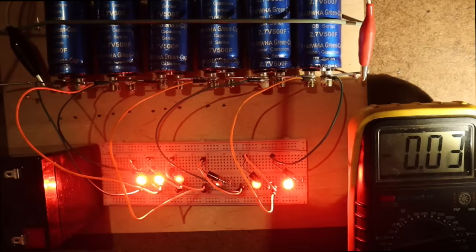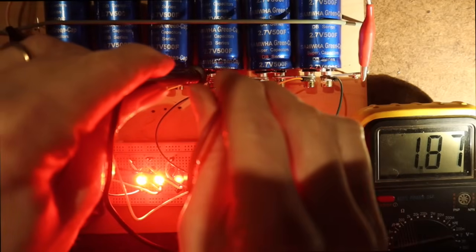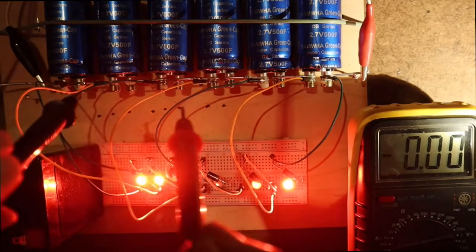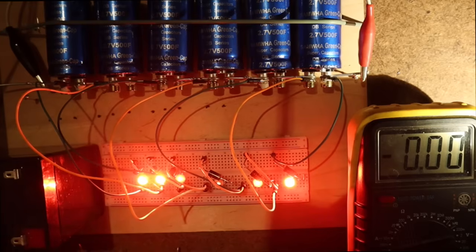2.25. So it's clear that the voltage of this power supply is always 12.7, because that is just simulating the regulator of the car, of the alternator. So that will stay the same. But if this weak voltage must go up from 1.87, it should also go to the others. Then of course these strong ones must go down, otherwise you will never get the sum equal to the power supply. And remember that in a car this circuit is constantly on the battery, so there's plenty of time that the voltages become equal to each other.